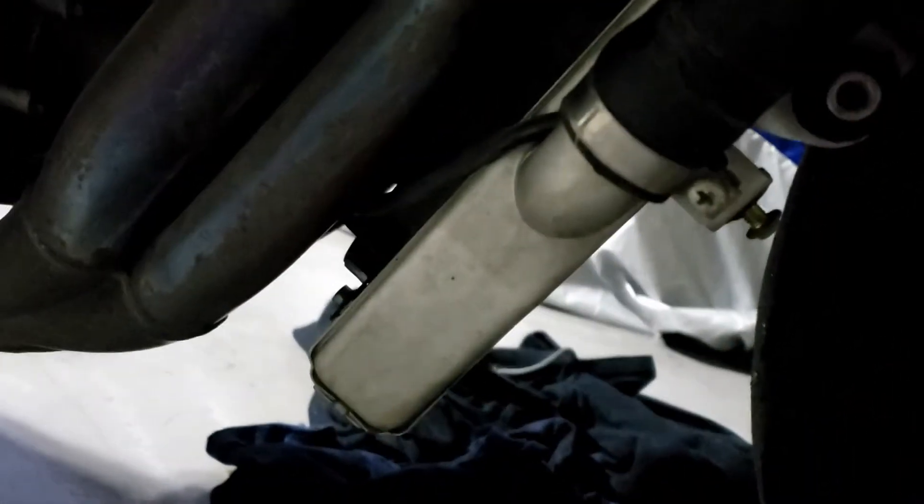Obviously disconnect all the electrical stuff from the radiator before you start. Followed all the instructions and it seems fairly clear from the top, but there's something down here still holding it in place, so let's investigate. Here's the bit the manual doesn't tell you — that bottom radiator, the little one underneath the big one, is fixed under the frame somehow.